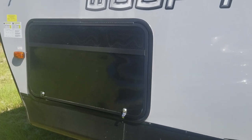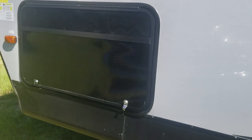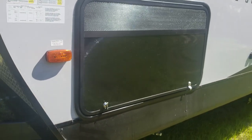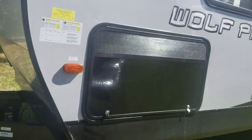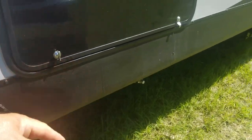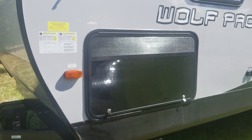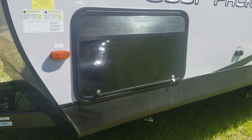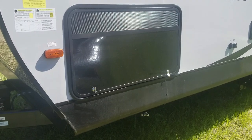I ended up putting something together for considerably less money. The problem with installing your own portable generator is that with any generator that goes in this box, you have to cut holes for the exhaust and run the exhaust from inside the box to outside, like underneath through an elbow. With the Onan that's handled, but with portable generators I was afraid to run it with the door closed.